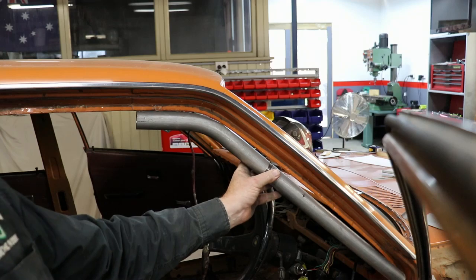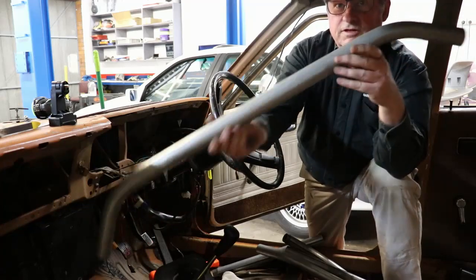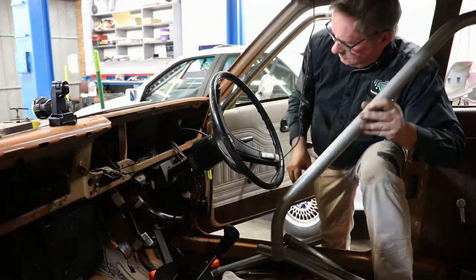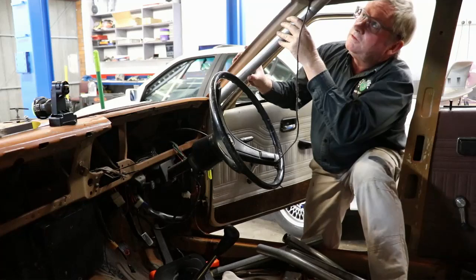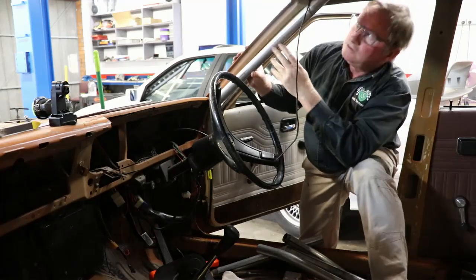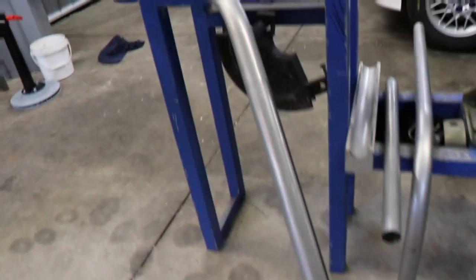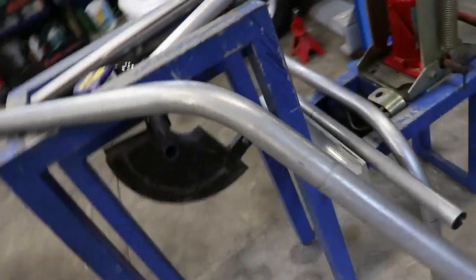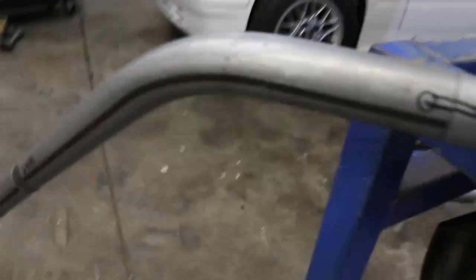There's the bar I was just showing you. This bend here will be at the roof, this one will be down to the dashboard. To do a test, just put it in — that looks like it's going to be the one we'll use. That's the first bar set up with the angles in it. That angle there is the drop down to the floor, this one goes up past the windscreen, and then see how it shoots across at an angle — that's my roof angle there.